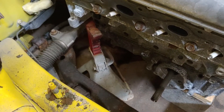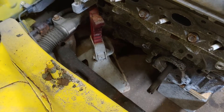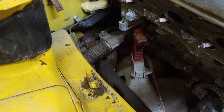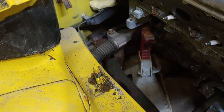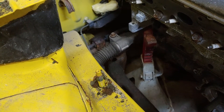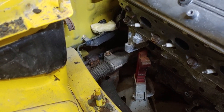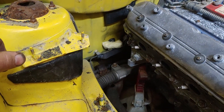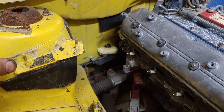This side should be pretty easy. With a V8 in a Cobalt I would have thought there wouldn't be this much room, but at a glance, as soon as that steering rack is gone and that K-member is gone, I think the frame rails should be outboard far enough that I'll be able to snake the exhaust right through there without any issue. I'm not sure I'll be able to do an X-pipe because I'm sure I'm going to be closer to the road than I'd like with the transmission.